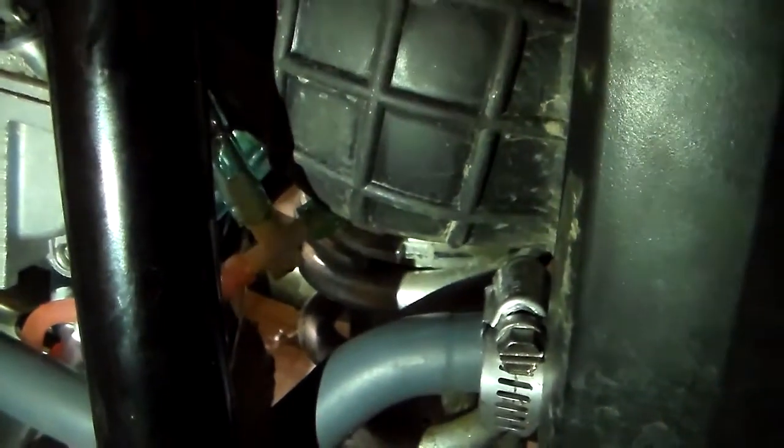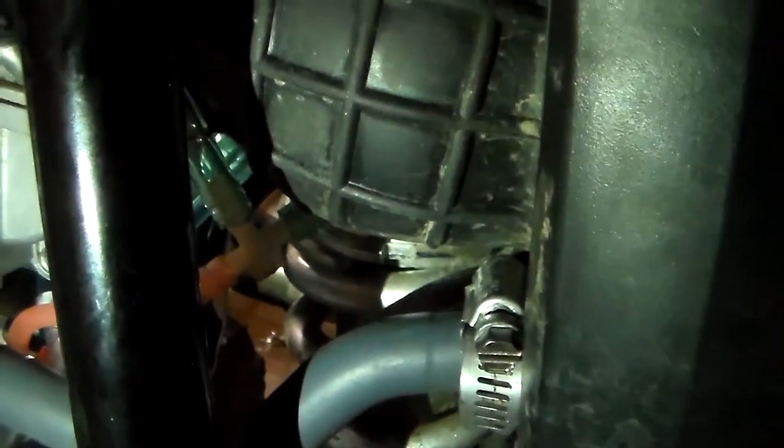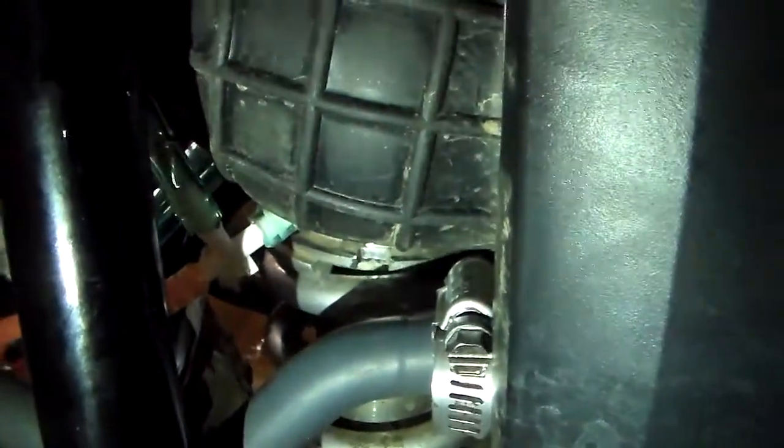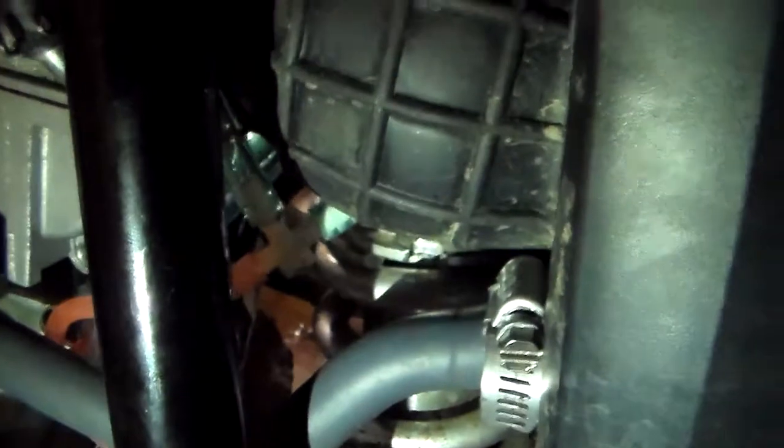So my carburetor had 3 ventilation tubes total. Each of the 3 ventilation tubes has a T on it, and now it has a total of 6 tubes. So what the T does is you have the tubes still going down here like usual, but then the other half of the T runs up here, and I have it zip tied up under the seat. So if for whatever reason you're going through water and these ventilation tubes happen to become submerged, your engine will not shut off because it can still breathe because it's teed off up underneath your seat.